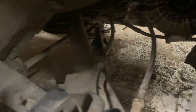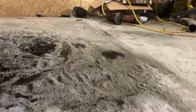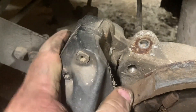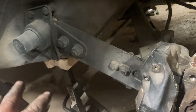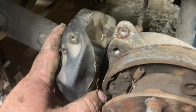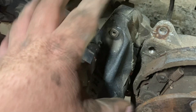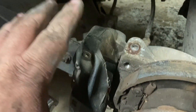We've got the rear wheels off and the car on four jack stands. Both rear CV axles are out — here's the driver side, passenger side over there. Both rear rotors are off; calipers are just loose and finger-tightened so I don't lose the bolts. Interestingly, the car has three new calipers on it — both fronts are new and the passenger rear is new. The driver rear caliper is not new, but there's a new one in a box, so we'll put that on. I also have Boxster S Brembos and the conversion brackets.